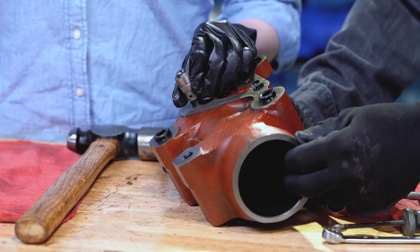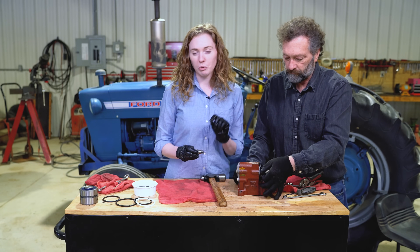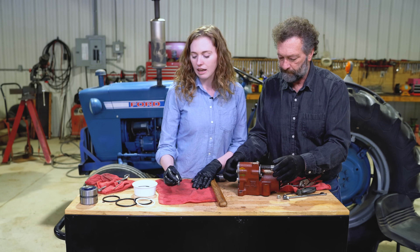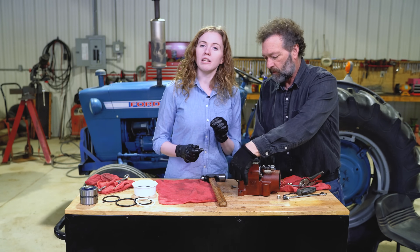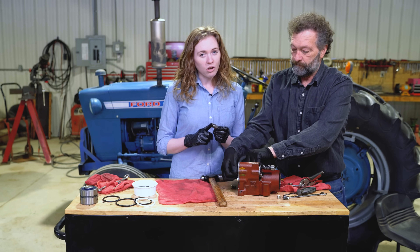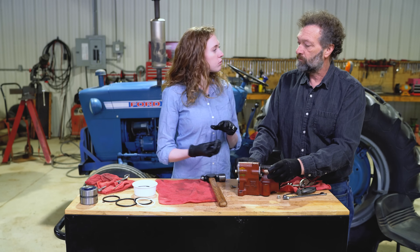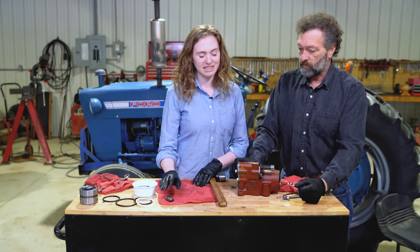I am choosing to remove the safety valve from my cylinder — you may choose to do the same. When you replace yours, make sure it has either a metal washer or an o-ring washer behind it. Some people replace their safety valve just to do a thorough job, and it is rather durable. Typically, if your safety valve is bad, you will have hydraulic pressure at the pump but no pressure at the test plug under the seat. However, a bad relief valve in the bottom, a bad o-ring between the top lid and housing, or bad o-rings on the tube could also cause that symptom.